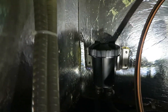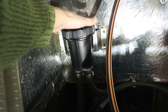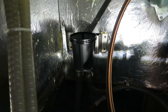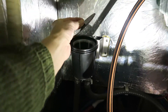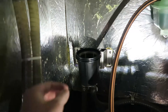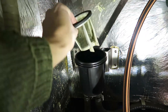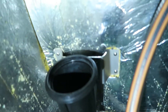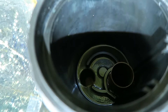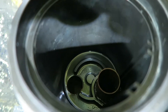First I take off the top of the water filter here — the water strainer. And then I remove the plastic plate here. And then I can remove the filter here. It is normal — there is standing water in the bottom of the water filter here.